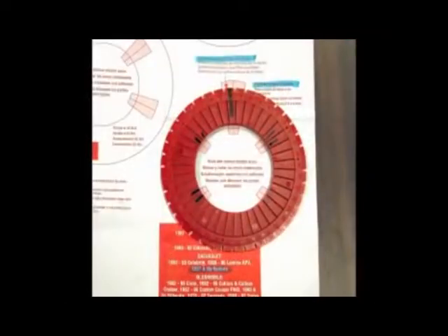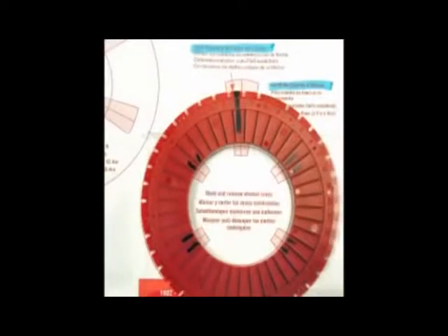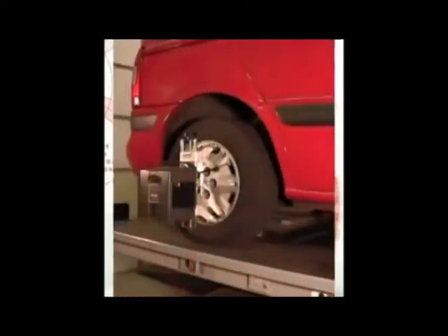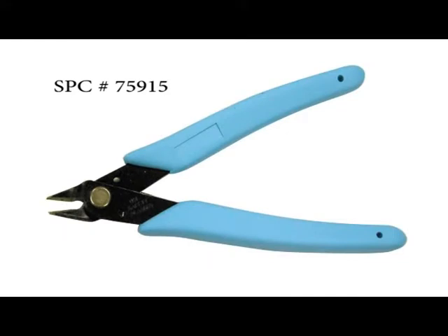Use the template on the back of the instruction sheet or the template on the alignment equipment screen and mark the shaded areas that will need to be removed for the rear hub bolts. The top shaded area may not need to be removed, so fit the shim before cutting this portion out. It is recommended that special cutters be used to cut the shim.